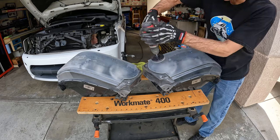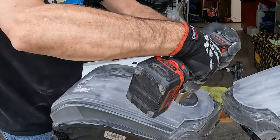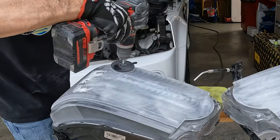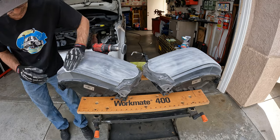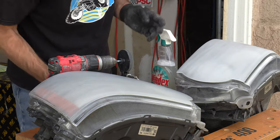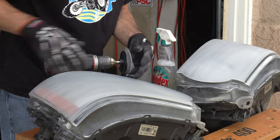I'm okay with our 500 grit pass — we can always go back. Now it's time to trade these 500 grit scratches for 800 grit scratches and lessen them up a little bit. Same principles apply on the 800 grit pass: keep a nice even pressure and smooth, consistent motion. We are now in the process of undoing the deeper scratches from our first pass, and I'll even use my hands to get into the contours of the lenses. Now that we have a fairly universal haze and it looks consistent, we're going to go ahead and get our 3000 grit pad, which is basically just a polishing pad.